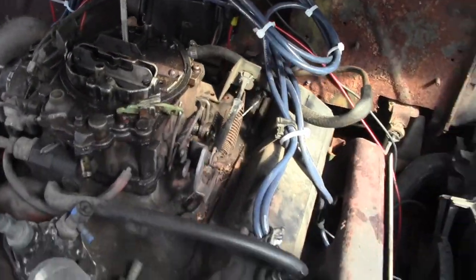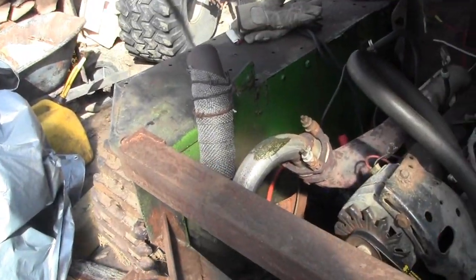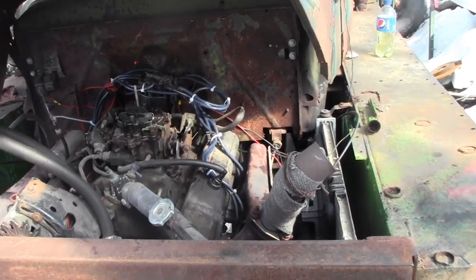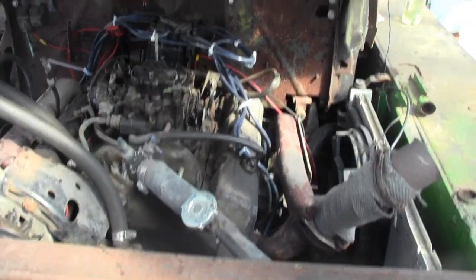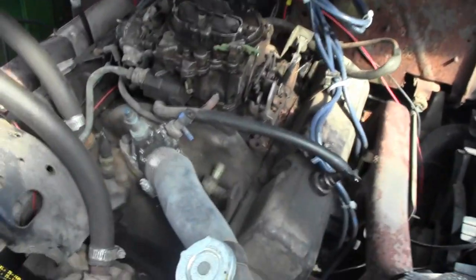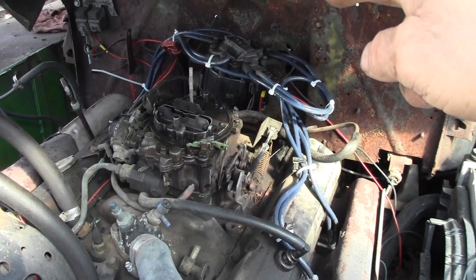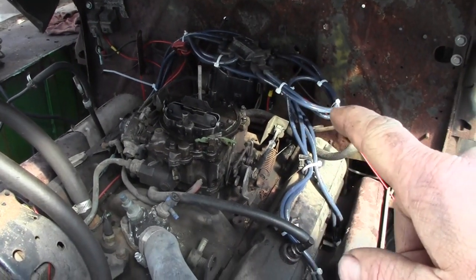We're gonna check the wires on the cap because it sounds like I have something out of whack here. You can hear it popping here and over there, so I probably have two mixed up. Alright, so my firing order is all correct. 1, 8, 4, something or other, it's all down there anyway. I just checked it, and the rotation is right. It's running like a bag of crap, like it's still misfiring.